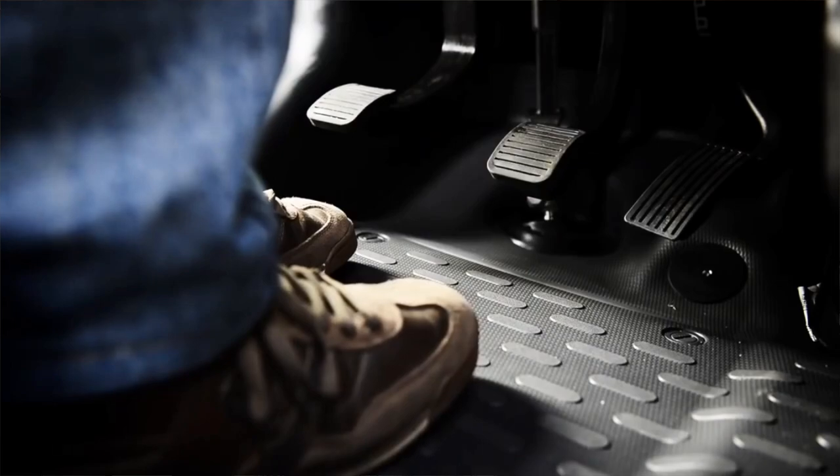There is a good point to mention about hill descent control. I've read a few posts where people have been saying it doesn't work, or asking should they use it on a steep hill on a normal road. No, that is not what hill descent control was designed for. In fact the system will not function unless the van is going lower than 15 miles per hour. Yes, you can still apply the brake while the system is on, yes you can press the accelerator while the system is on, and of course you can turn the steering wheel. However, whilst you're pressing the brake yourself the system will not be functioning, and whilst you press the accelerator the system will not be functioning. But if the button is pressed in, it will function when it's below 15 miles an hour and you're not pressing the brake pedal and you're not touching the accelerator pedal.